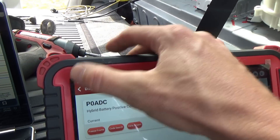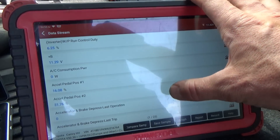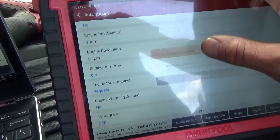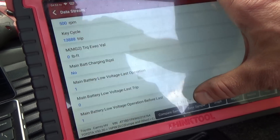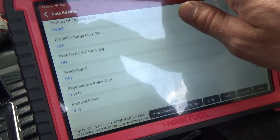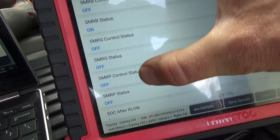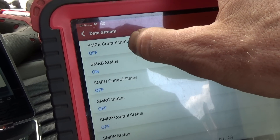In the hybrid control system wiring diagram, here's our hybrid battery junction block assembly — three relays — and the gray wire controls SMRB. Let's find this block and check live data on the scanner. There are 23 pages of data. Looking at page 21, you can see why new cars with multiple drivetrain systems take exponentially more time to diagnose. Here we go — SMRB control status and actual: SMRG and SMRP both agree they're off, but SMRB is stuck on even though the control status says off. That's a problem.